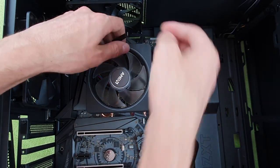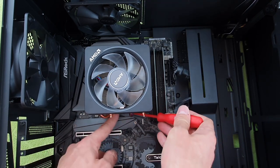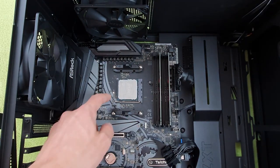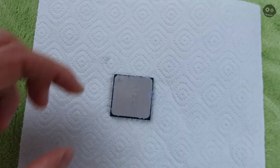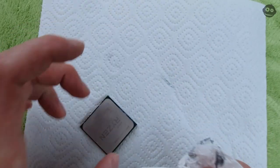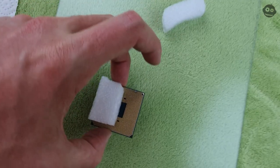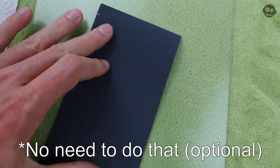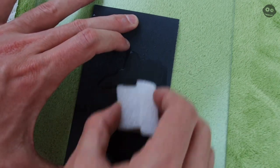The next thing is to remove the CPU cooler, which is always a fiddly thing to do — be very careful not to break components on your mainboard. Then we remove the CPU. We have to remove the thermal paste that was applied from stock, clean the CPU very carefully, and what I will do here is lap the whole thing. I put some foam on the back of the CPU to protect the pins, then took some fine 600-grit sandpaper and sanded down the CPU.